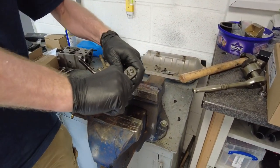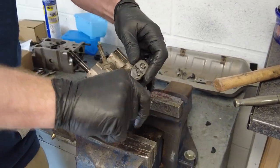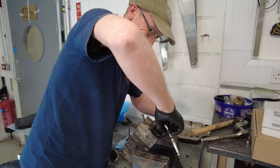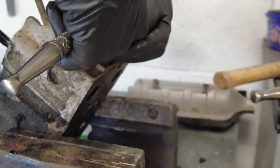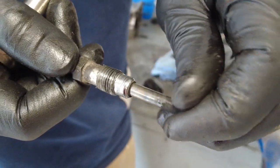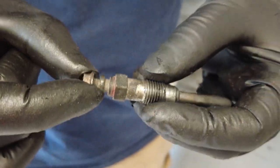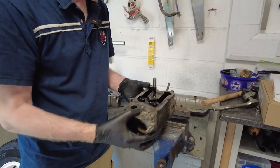We'll take the glow plug out — this is for the diesel; it heats up the diesel so you can start on a cold morning. They're actually real tricky to get to when they're in the car. It's jammed — I might have to spin it out. There we go — I think it's furred up at the end. We'll check it with a multimeter later; as long as it's got resistance, it's good. You can see the red insulating collar — you put voltage on these to heat them up and this end bit glows red.